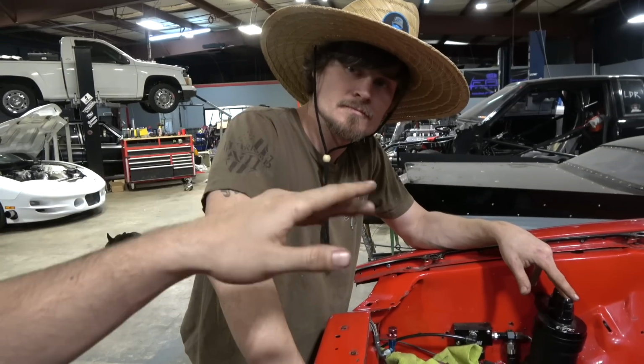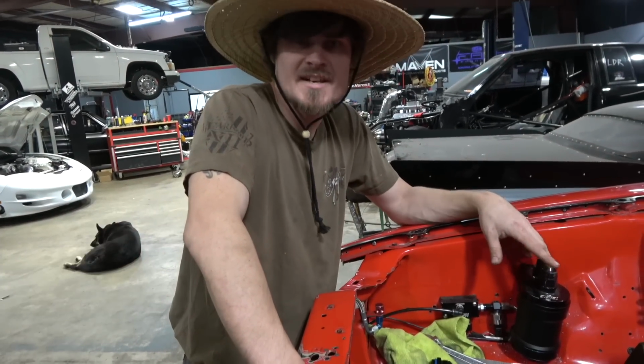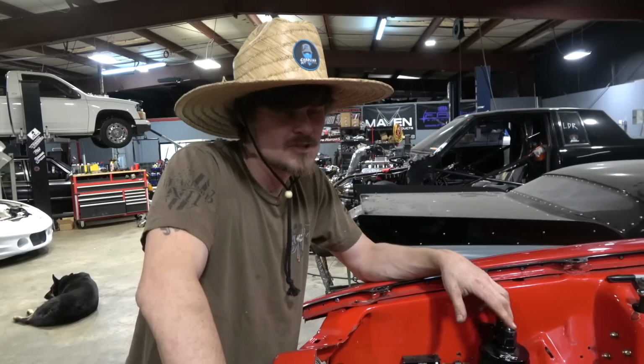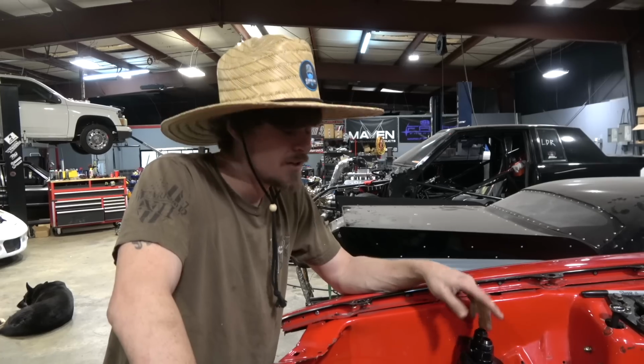You've got to think, our pump, all of it is dash 8, and everyone's like, oh my god, it needs to be bigger. No, dash 8 is good for 1600 horsepower on E85. It's 30% more fuel volume than gasoline. I would push dash 8 probably to 2000 horsepower, especially on E85.